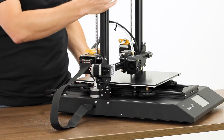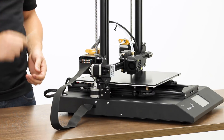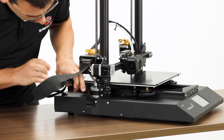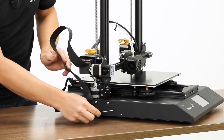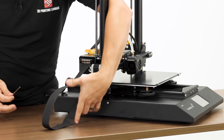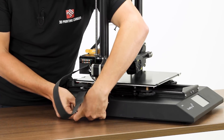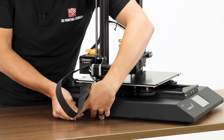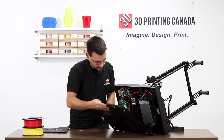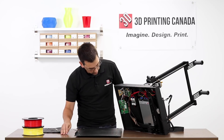To open the base, flip it on its side — it gives a nice flat surface to rest on. Remove all the small M3 screws on the bottom; you don't need to undo the screws that go through the feet, as those don't secure the bottom plate to the base shell. There are two final screws on either side as well — take those out last and the bottom pops right off. If it's a little sticky, put slight upward pressure on the base plate. Be careful not to crush the ribbon cable when resting it on its side; the feet are still attached.